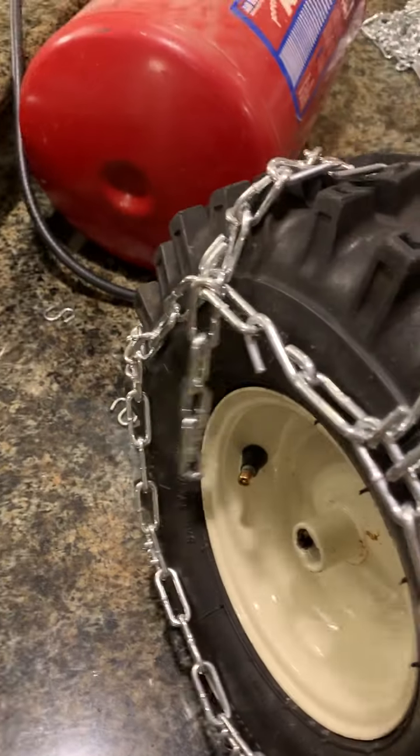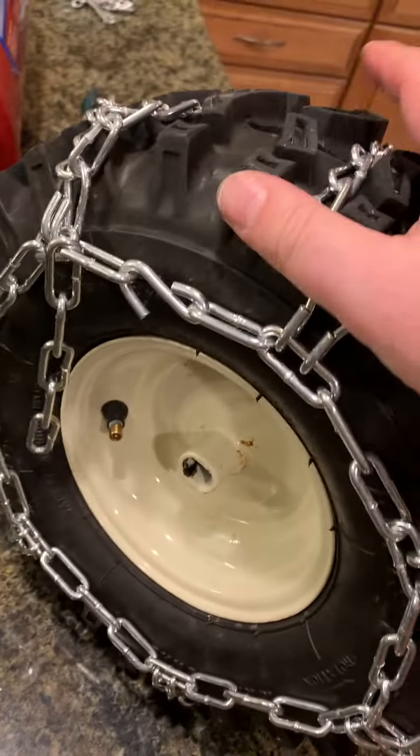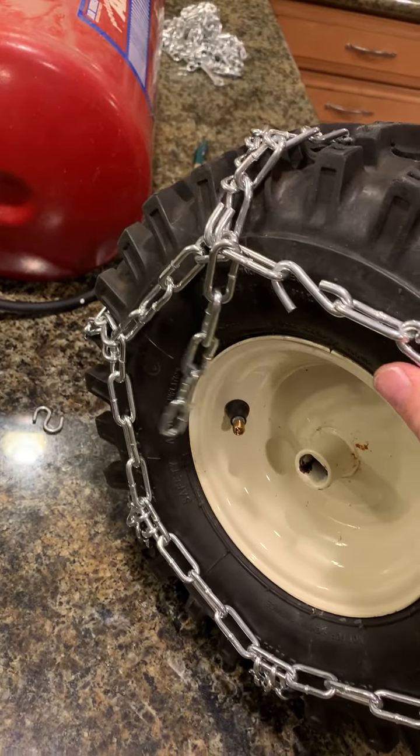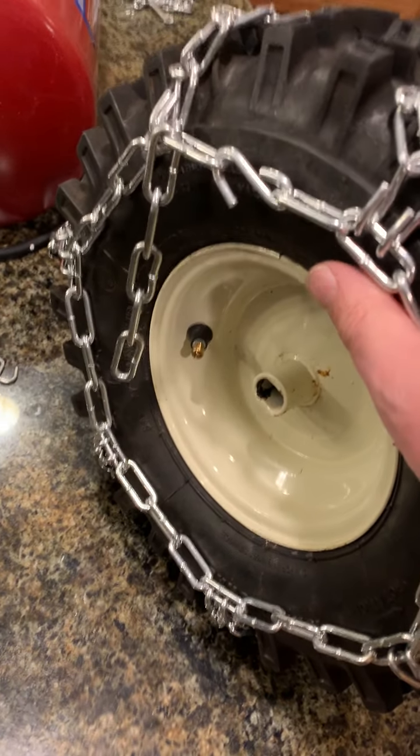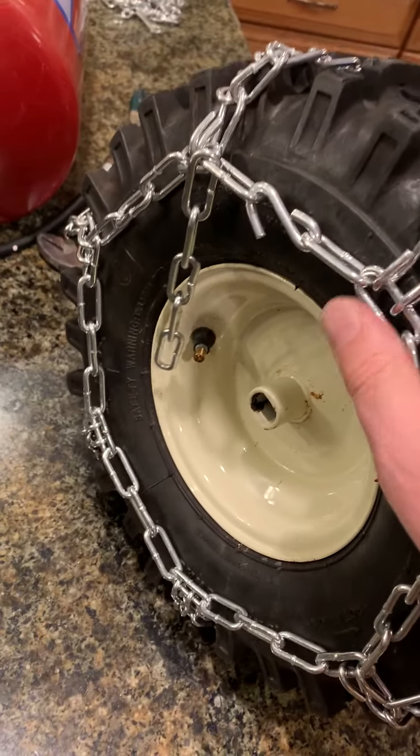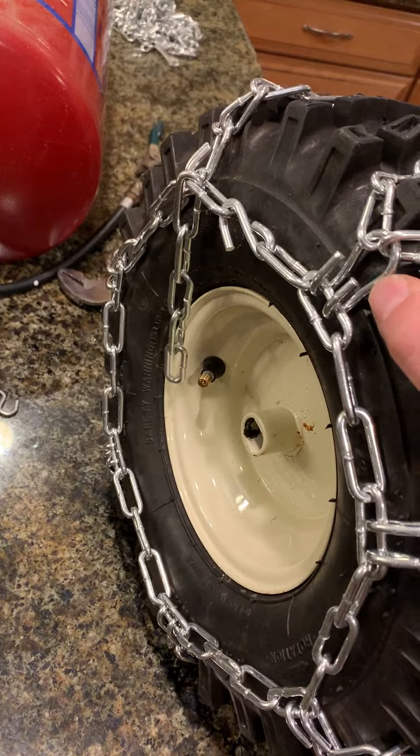Other than the clanking, this is drawn up nice and tight. There's 22 PSI on it — yes, I know the factory spec is 20, but try getting exactly 20 PSI. It's nice and tight; you don't need chain tensioners, you don't need anything. Just take the air out, adjust it, air it back up — it'll expand just enough to draw it tight.